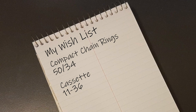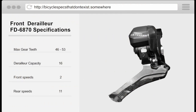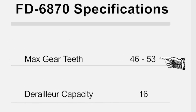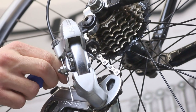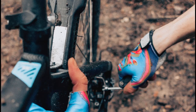Now I need to find out if these parts are going to work on my bicycle, and I need to know the capabilities of my derailleurs — now you see why the derailleur number is important. I went online to get the spec sheet for the front derailleur, and found it can work with any chainring between 46 to 53 teeth. That means the 50-tooth chainring I wanted should be no problem. Now I had to check the total capacity — you may also hear it called derailleur capacity or chain slack. It's something I never thought about and sounded really complicated, but it wasn't. I made sure that the new parts did not exceed the spec for total capacity. If they do, the derailleurs will not be able to tension the chain properly, and you'll end up with bad shifting or worse, a broken derailleur. You'll find total capacity listed in the derailleur specifications, but you won't find it written anywhere on your bike parts — that's why you have to do a calculation.